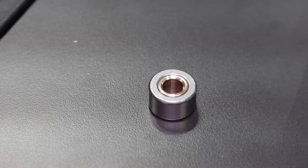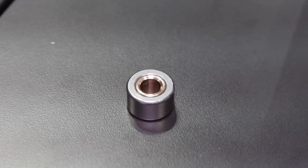And these do not have needle bearings, correct? No they don't. They're all bush. They use a proprietary bronze alloy bushing which makes them much safer than a needle bearing lifter. So in the event of a failure where you would have needle bearings all throughout the motor, you don't have that to worry about with these.